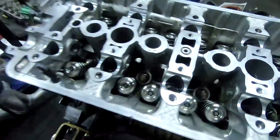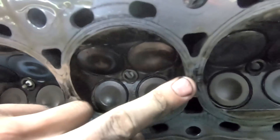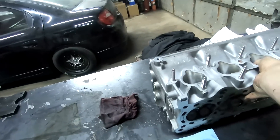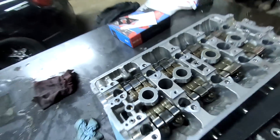We're just cranking away here - check that out over on my dad's channel, PFI Speed. We are slamming these engines together. Eric just got his completely ready to drop the motor out - we got to send his off to get decked because he fire-slotted it pretty good, the block's even a little worse. So Sean's gonna go ahead and drop a few beads right there. We're gonna have this decked and then disassemble his block and deck that as well so we can get Eric back on the road and get him to PSA hopefully.